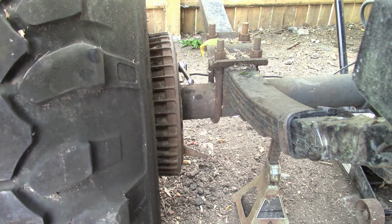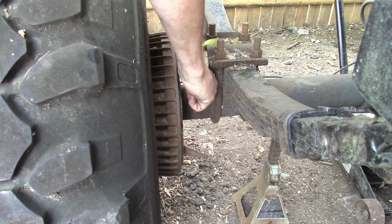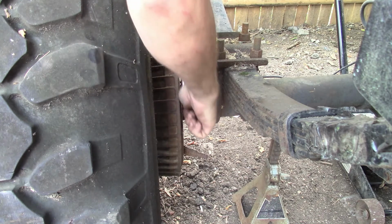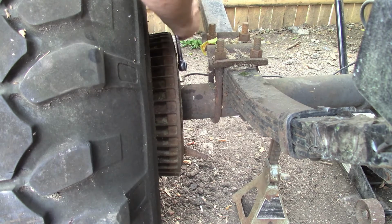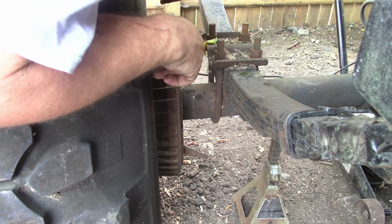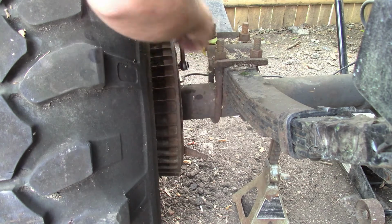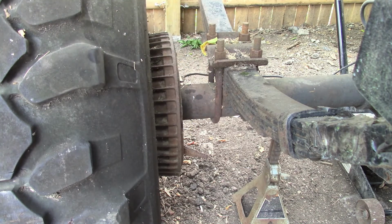I got lucky, I think, on this wheel cylinder. Actually found a 6.38. I believe I got it to come loose. Driver's side wheel cylinder came loose, which I figured it would. See if we can get this to where fluid will start dripping out. Man, that sucker is tight. Yeah, I figured it'd slip or snap, but there's still no fluid. But crank her on out, maybe it's plugged up. There she goes. I think the bleeder's plugged.